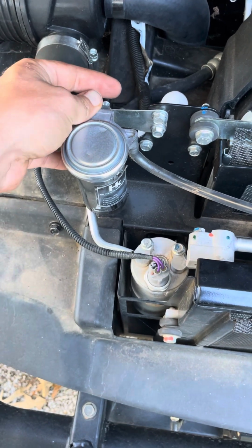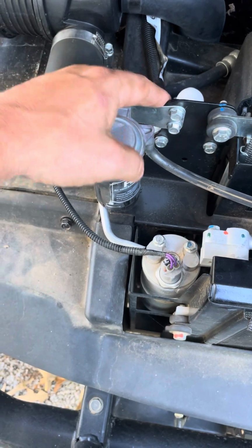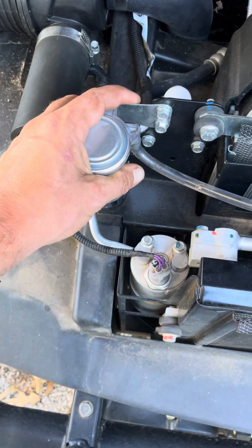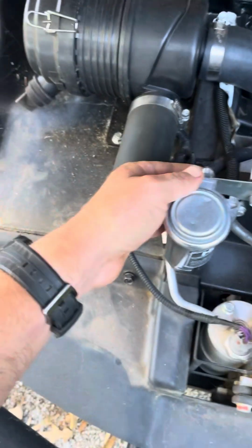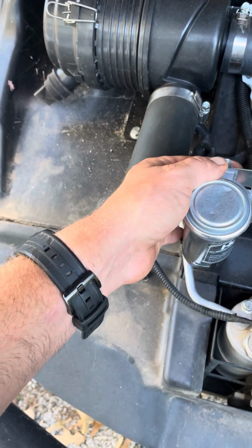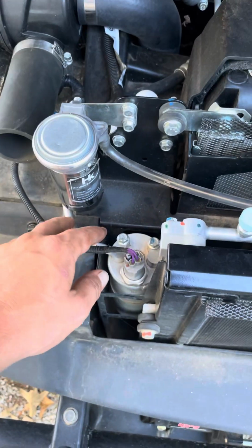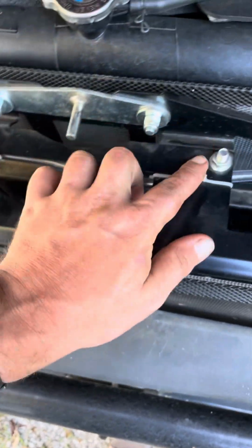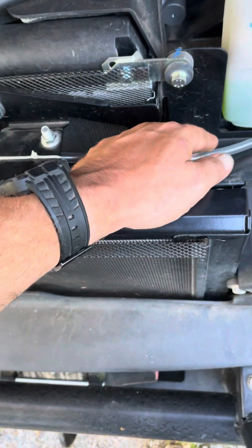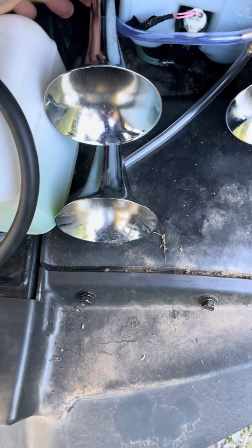This bracket actually came from a wall up. Well, oh wait, no, I take that back. This is the stock horn bracket. I'm sorry. So you take the stock horn off, keep the bracket. Just drill the hole out a little bit bigger to fit the bolt. Mount the compressor here. Buy you a run of hose. Run that down. Mount it here. Run along here. Go into the first set. Cut it off there. It'll go back up in there in that first set.